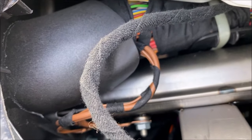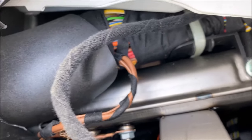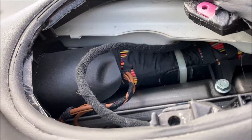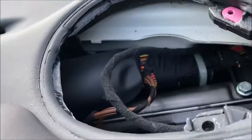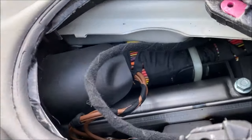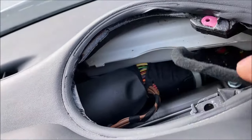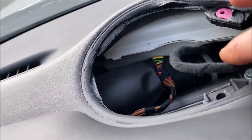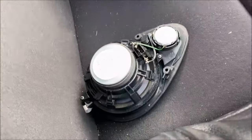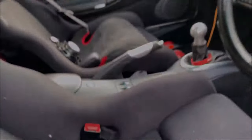I've got both speakers out. This is the plastic shroud everyone talked about - over in that back corner, top left, you've got that plastic shroud covering up all the cabling. That is what everybody is concerned about hitting when trying to put the speaker in. You want to keep the speaker cable away from it - make sure your cabling is on this side of that shroud to give you the full depth. Let's mount the speakers up - same principles apply, mount them to the front adapters of Super Paulie's mounting kit.